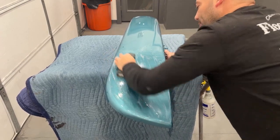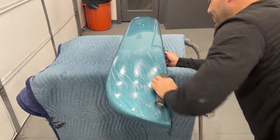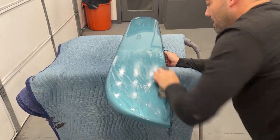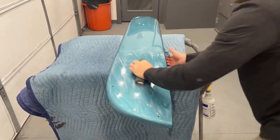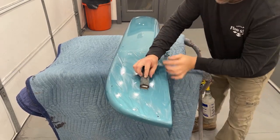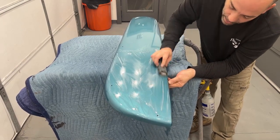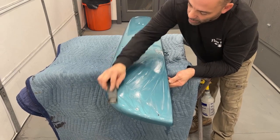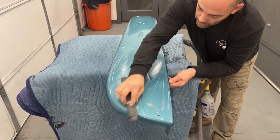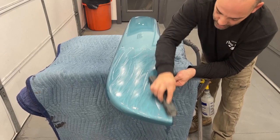I've tried it multiple times. I see people do it on TV and YouTube — it does work — but I can never seem to get it perfectly flat. The foam pad definitely helps that process. So I just hit this little spot here with 1000 grit. Let's wipe it off — we'll use that paper towel. I gotta go get my squeegee, but for right now we'll just wipe this off with the paper towel so you can see what it looks like. It should be a lot duller looking.